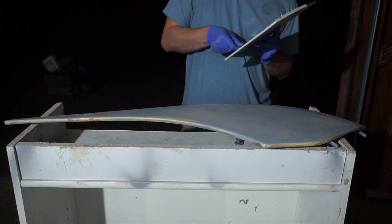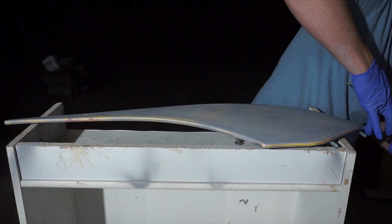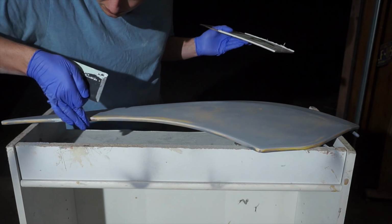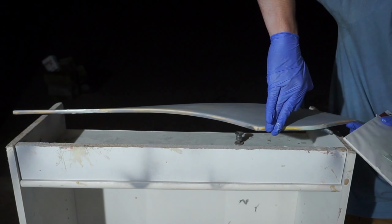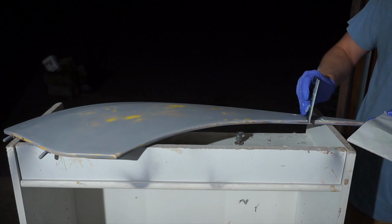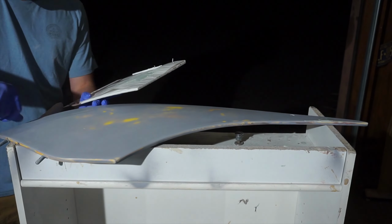This particular part had a few areas which needed some lightweight body filler and sanding, specifically in the areas I repaired, quote-unquote, many videos ago, and if you've been watching the past few videos, you should be seeing a trend here. Also, the random areas of mismatched colors, like yellow and stuff, that's normal. That's just from the primer being sanded through, and then the final layer of primer we do will cover that completely.